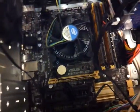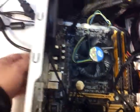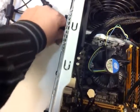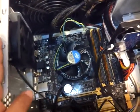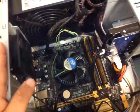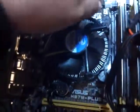Now we are ready to take the processor off. It is ideal to have all the power cables unplugged — you could still get power from the monitor, so it's ideal to unplug the DVI cable and the rest. Once you are ready, if you have a tool to ground your PC, you can attach it here; otherwise just go ahead.